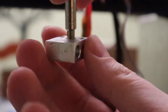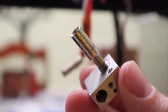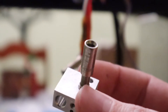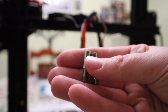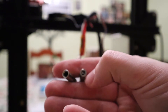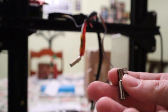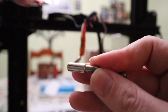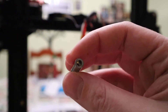I got this all loose now — it took a lot. I actually had to put this in a vise and put a vise grip on the heat break to break it loose, but it was really in there. I think Creality put some thread lock or something on there. So here are the two different heat breaks. This is the all metal one on the right. If you take a look on the inside, you can see there's a lip right at the top of this heat break — that is where the bowden tube stops on this one, as opposed to the other one which goes really far down. This one is going to give us more of an all metal hot end.